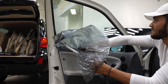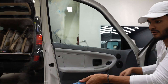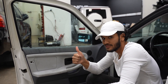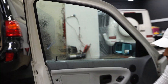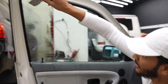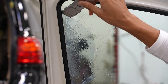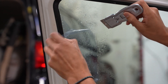You can come off in 10 pieces if you want, just don't leave me any residue. Now that we have the majority of the window tint off, the cool thing is we have no residue left — that's always a great thing. Only thing left is just a second layer of tint. We're going to go ahead and get a new razor blade into our blade holder and scrape this off, trying to get all the glue that stays behind, because we don't want any of that to contaminate our new tint job.